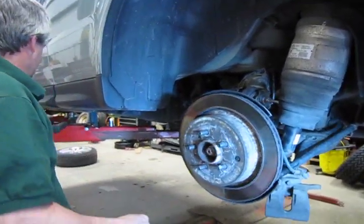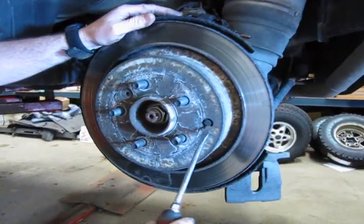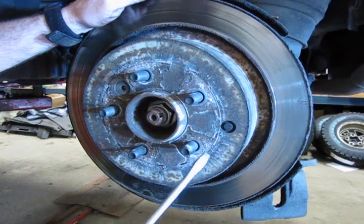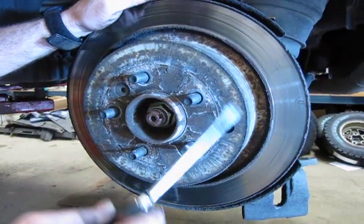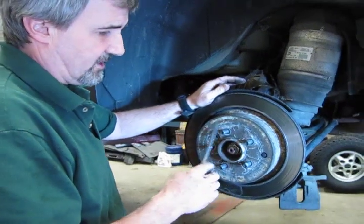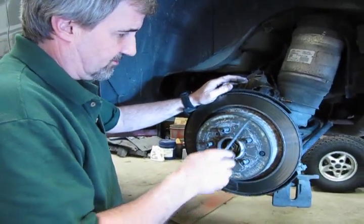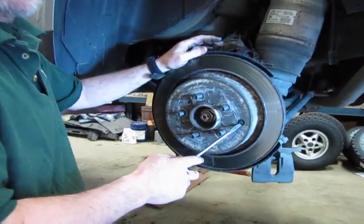Alright, now, taking the rotor off. There's a small plastic access plug in these rotors. One thing you want to look for on some of these, that there were issues in the past, if the park brake pads, or actually their shoes, should create an overheating situation, you'll notice a discoloration in the rotor, but in many cases you'll find this little plastic plug melted.